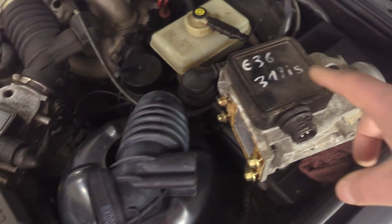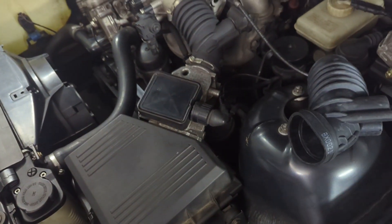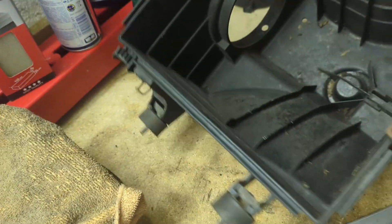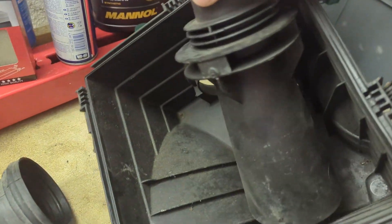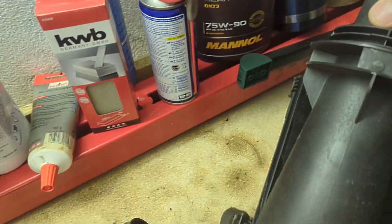I also got the M42 air box. I don't think there are any differences in the air box, but we'll measure and compare once I've taken this apart. It'll be interesting to see any difference in the diameters and the intake snorkel — or this trumpet noise reduction thing inside, which I've already taken out. I'm probably going to delete this because it goes like this to reduce intake noise, and to me that looks like a hindrance to airflow since the air has to go through a small opening. Deleting it will be more free-flowing.